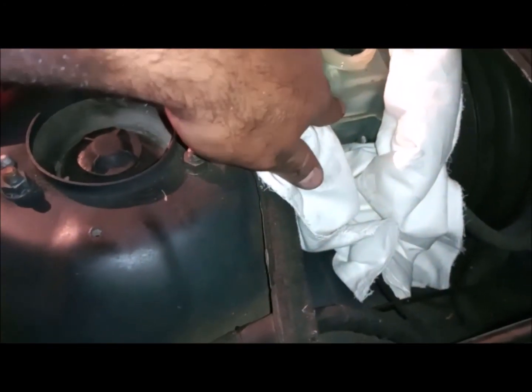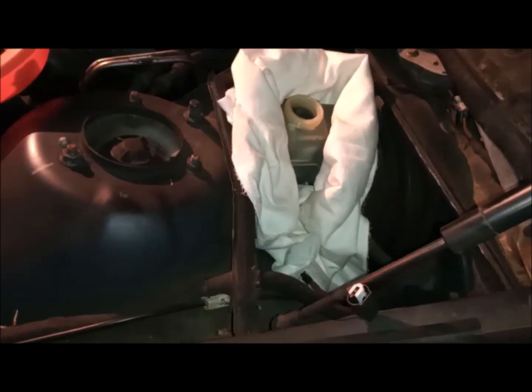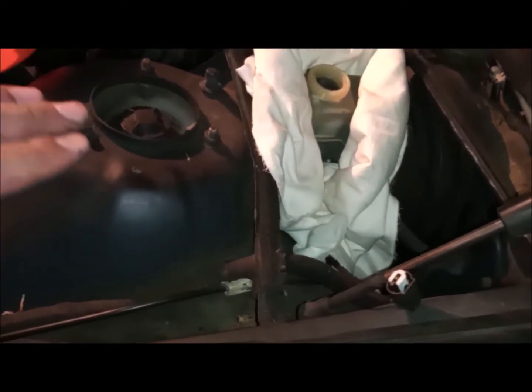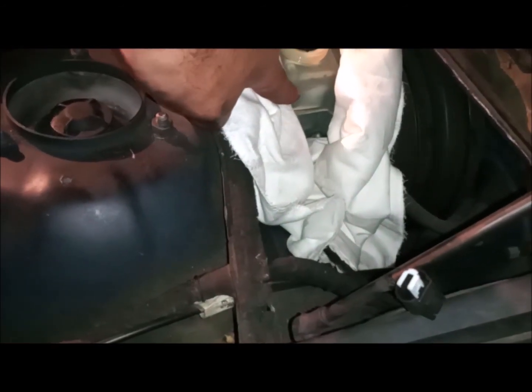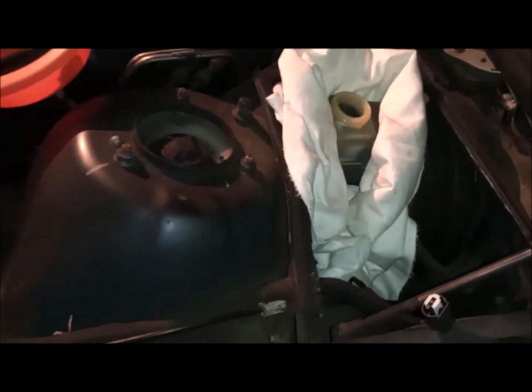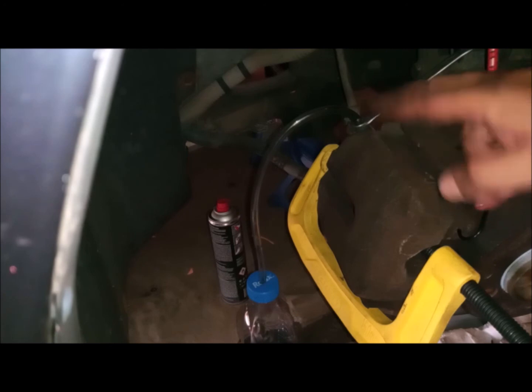I just watch the reserve. I make sure that it's just up to the maximum. And actually each tire didn't reach the middle, so it didn't exceed the minimum. I used around 750 ml of brake fluid. Of course, I always use unopened, fresh, new brake fluid. So I took 2, each one is half a liter, and I didn't use them all.